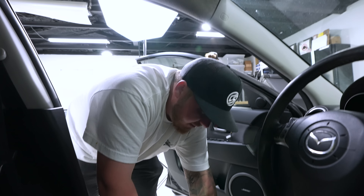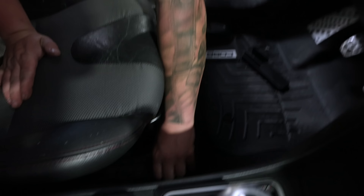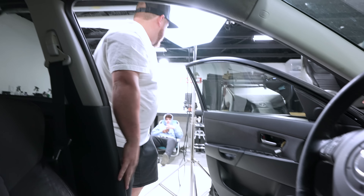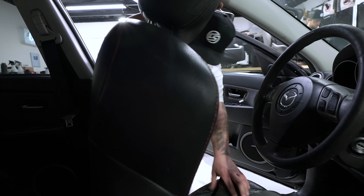To pull out the factory seats, we have some plastic covers down here. To remove those, you just get your hand back here and pull those up. I believe those are 14 millimeter bolts. Slide the seat forward, tilt it to the side, and do that move right there. Come to the back — same thing back here; we have some tabs.